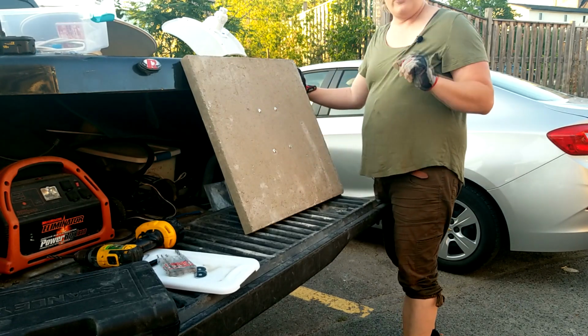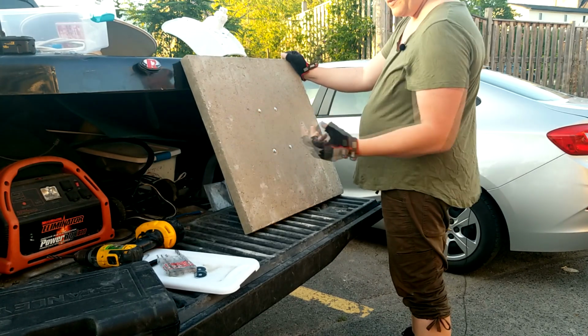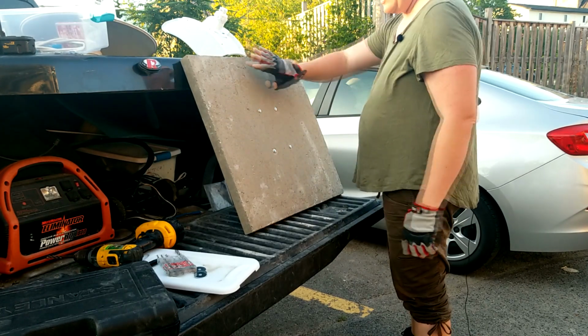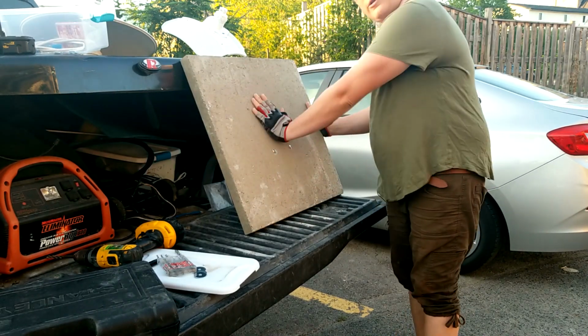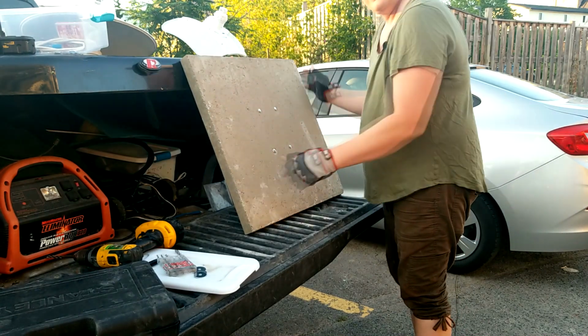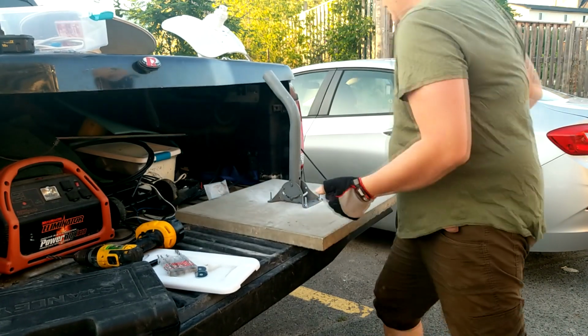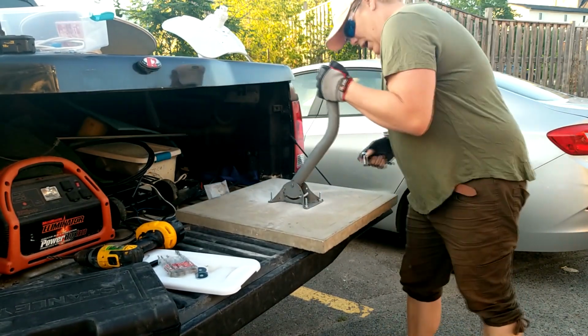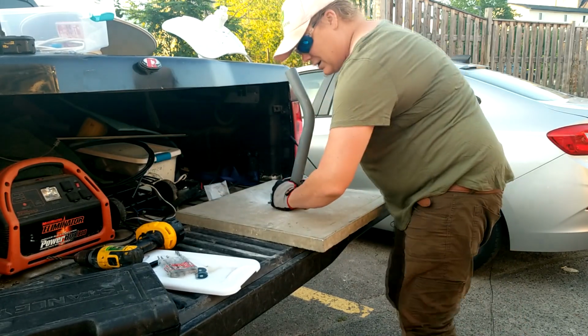But another suggestion, by the way, is if you do put this on a building, you want 2-inch styrofoam underneath it, or 1-inch styrofoam, the heavy-duty stuff. And on trailers, you can actually put a rubber mat or a piece of tire underneath this as well. Make sure it's wide enough, and then I'll add additional protection to the roof. So now we need to erect this in the appropriate position here.